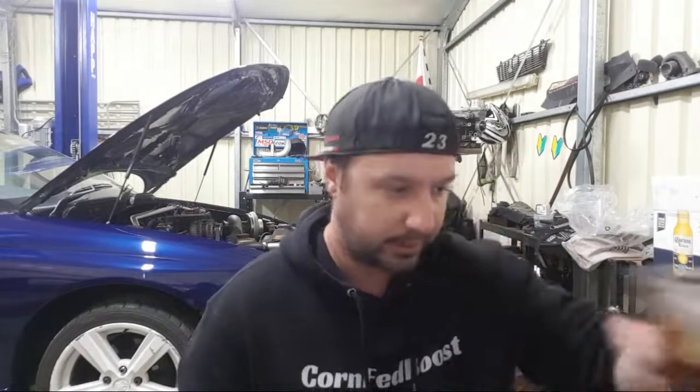Probably leave it. Hey Cryptics, what's happening, man? Well, thank you. Small rear housing will help, man. That's why I went with it. I think it was the smallest that he offered for it. He did offer a 73mm turbine wheel, but I didn't want to go with that and choke it out as well. So a bit of nitrous will fix everything.